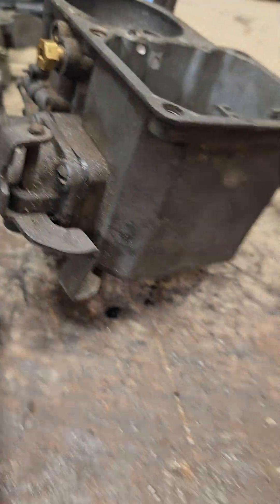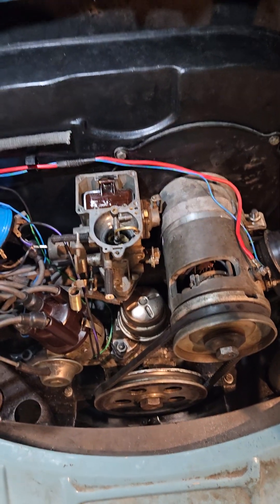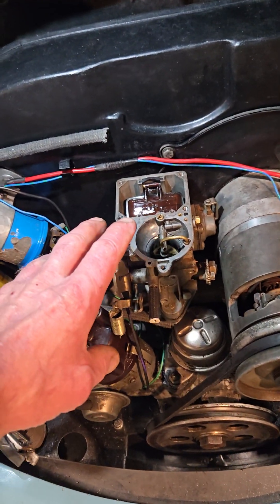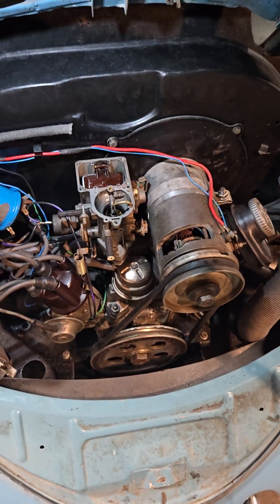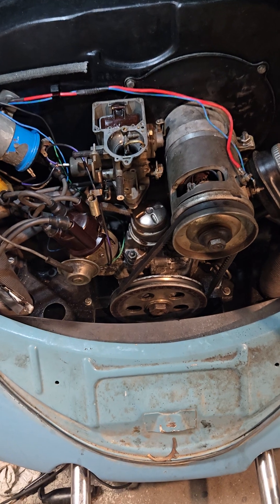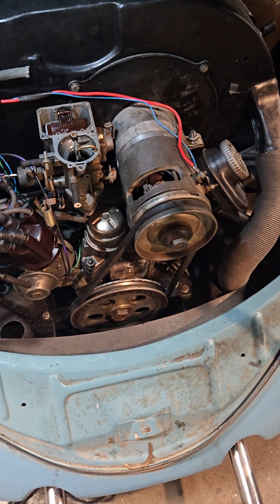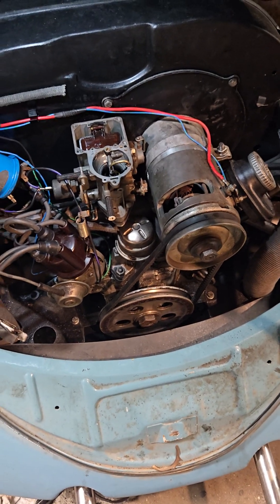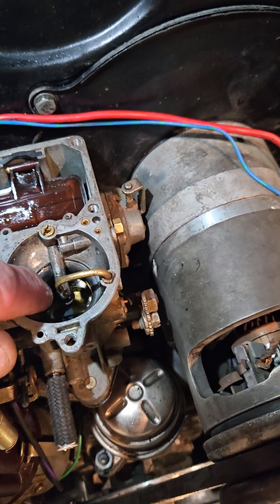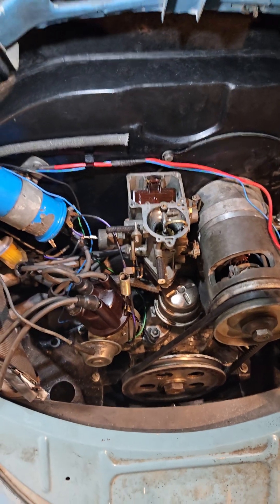What's interesting: the spray pattern I told you to use — I had the opportunity to look at a VW bug with 6,000 miles on it around 1980. We were having problems with this back then, and I asked if I could take the air cleaner off and look. It was aimed exactly like that — that's how VW did it from the factory. I don't know why the book says otherwise. There was also a '73 bus someone bought with dual-throat Weber carbs on a stock engine — it only got 8 miles per gallon in town. Webers will work on anything because they have that extra venturi in the middle. That's what pulls the fuel, and that's why they almost never have flat spots.